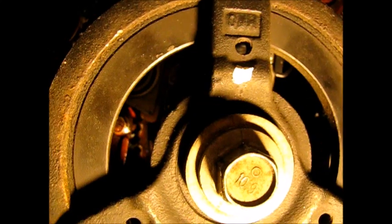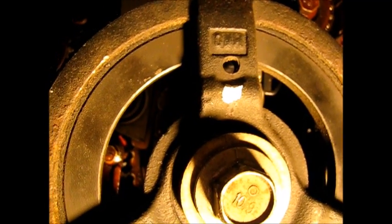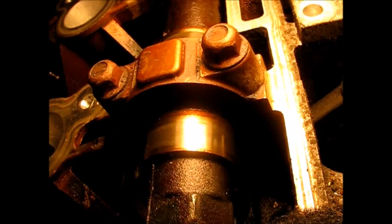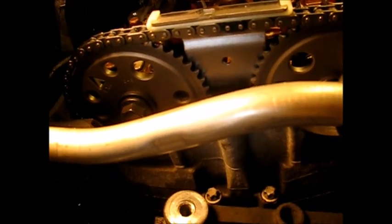The piston is up — we're at top dead center after exhaust. There's our crank at 12 o'clock, zero degrees, our starting position. The position of the exhaust cam is about seven o'clock, having come off the exhaust valve. Moving over to the intake, it's about five o'clock, approaching the intake valve. Our sprockets are at 10 on exhaust and two on intake. Okay, we're going to crank this by hand now.